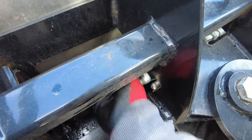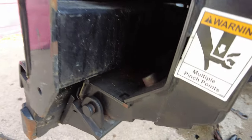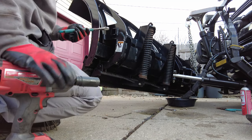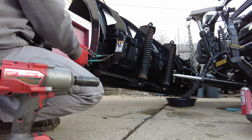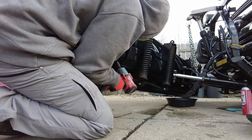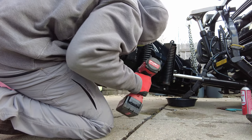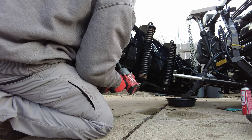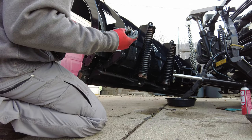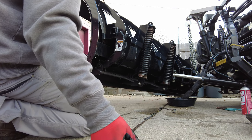So the two hoses are off and the cylinder is loose. Next, I've got to pull this big bolt out of there. I've got this great big impact right here, and I bet I can hold the top side with just these channel locks. It does give you an Allen, but channel lock should work. Done in reverse — 15/16th. This seems to be working. Easy peasy. And that there — that's all there is to the bump stop. So, grade 8 bolt. Hopefully this comes out. Never did this before.